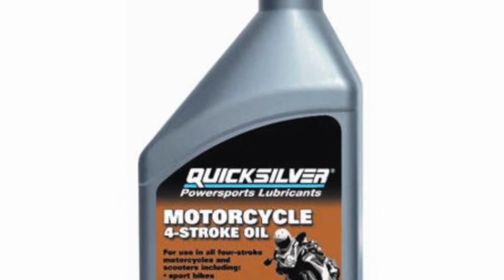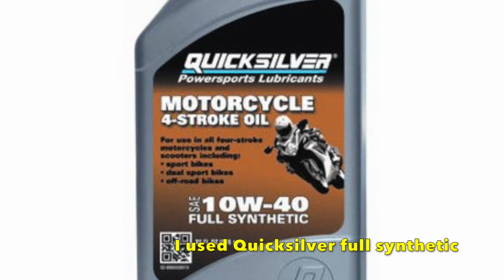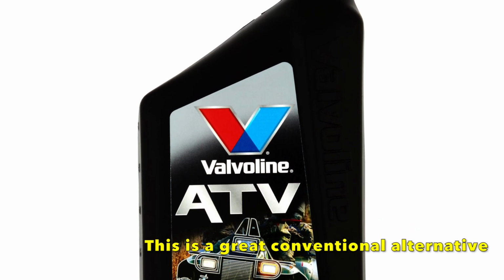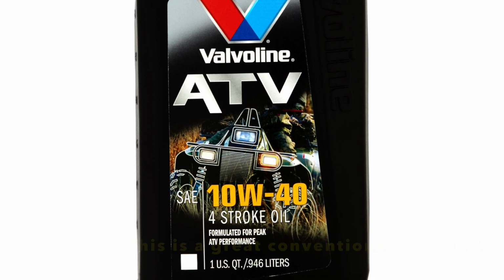Also remember that it's an automatic transmission, at least in this model, so it shares the oil with the engine, which means you need to have JASO certified oil at the very minimum. Just check your owner's manual, make sure you get the right certifications on the oil so it has the additives in there to allow the transmission to shift and run properly.